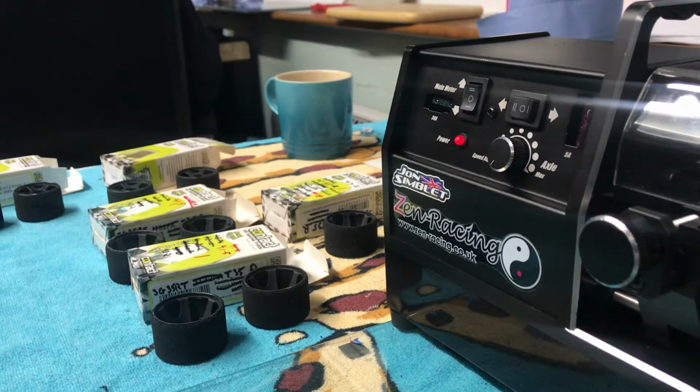But as a result, because the smallest rear tyre was 41.2 and I wanted 2mm stagger, I need my fronts to be 39.2. So all of my fronts are bigger than that, so I don't. So it's the rear tyre that's going to dictate what I true them to. Yes, it does mean that I waste a little bit of rubber, but it's worth it just to stop myself going insane, frankly.